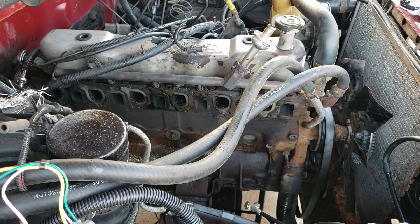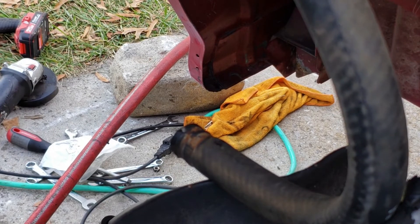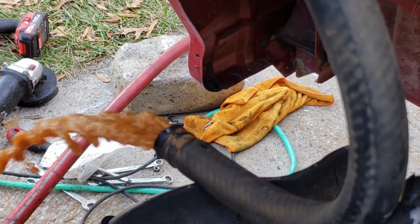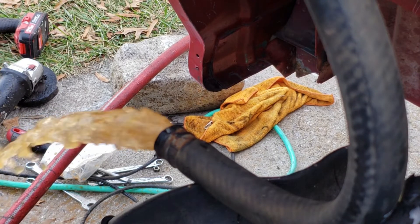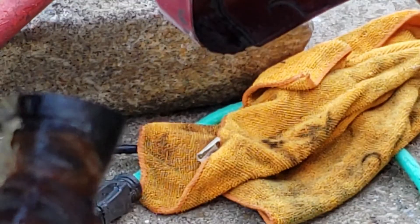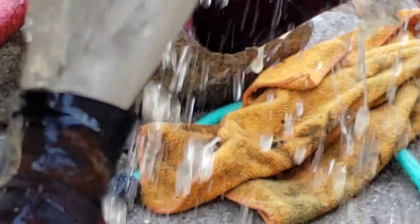At this point, we've got the engine all pulled down and ready to start putting things back together. I still have to pull the valve cover because I got a new valve cover gasket for it. When I went to drain the radiator, I had to drain it by pulling a hose because the petcock is completely clogged. So I took the radiator out back and flushed it out really good — got it all nice and clean. Then I came back to the truck to do the heater core because I knew it would be nasty too. I flushed the heater core and you can see what's coming out of it. Even after I let it run clear and back flushed it one more time, it still had crap in it. I did that a couple times and got the heater core all nice and clean.